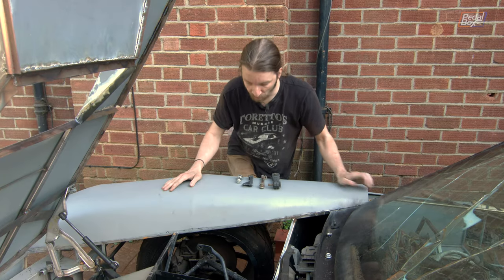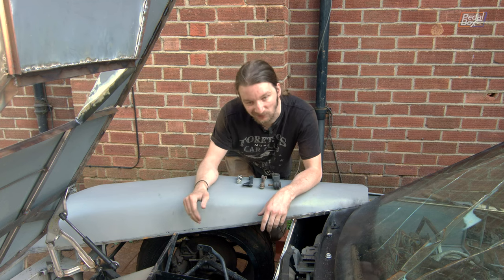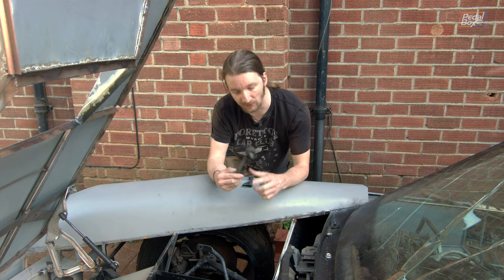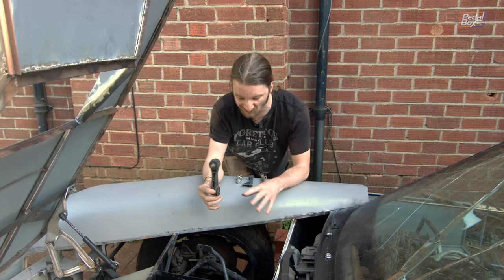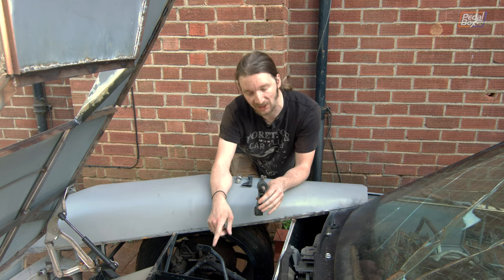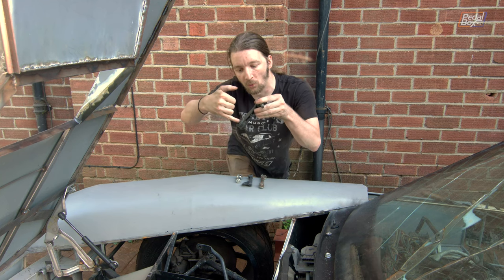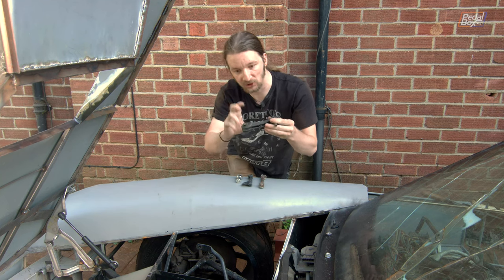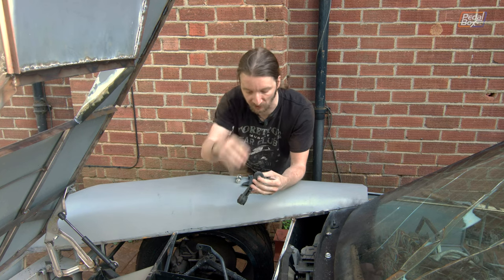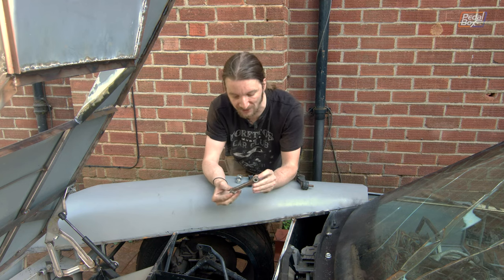The last thing we want to do before we stick a cover on the top of the wheel arch and button everything up — while we've still got access — is put in those new drop links. The original factory drop links fit on this way around, and unfortunately, although they were kind of okay with the original anti-roll bar placement, when we moved the ARB back to clear our new fan duct they ended up leaning back way too far. The pin here wants to be directly out forward, so we're putting a huge amount of stress through this little rubber joint, and we're pretty sure it wouldn't cope with how far back it would have to go under compression.